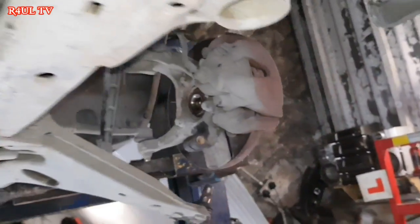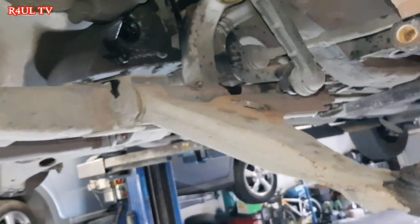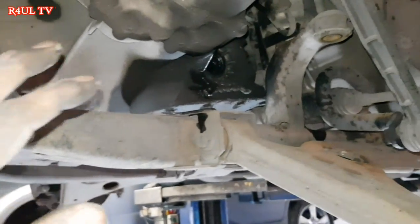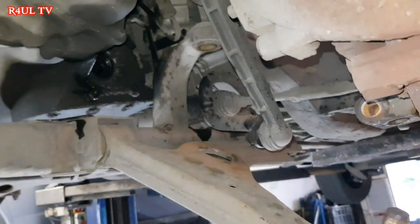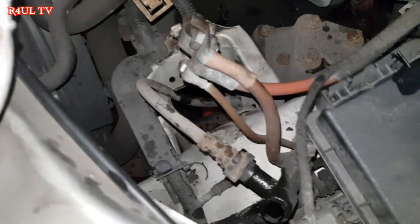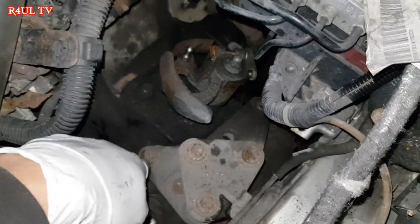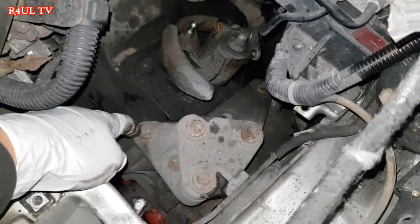So now if you look at it, I can pull this subframe down, gearbox. What we're gonna do is rest it onto the subframe, take it off and rest it onto the subframe. Sent the car down and everything, took the hydraulic slave cylinder pipe off. What I'm gonna do is crack these, take these bolts off,